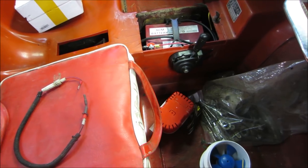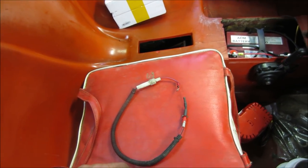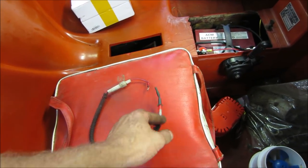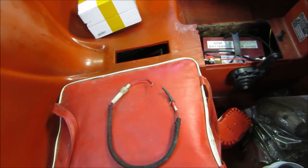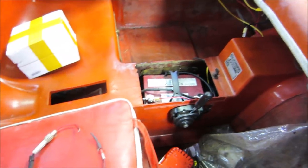That's the blower — it'll allow fresh air to come in from underneath the seat, goes through like the factory did, and helps purge the engine heat. We want to put a bilge pump in so if we go into the water and it starts to take on water, we just don't go under. The charging system — I kind of omitted some of this stuff on the last video for the sake of time, but one of the issues was I did not have the diode in place.